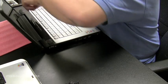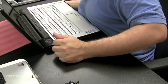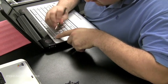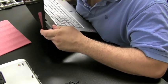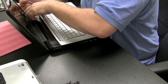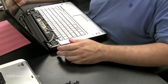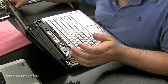The first thing I'm going to do is get that hinge cover plate off. It's different on every laptop — some laptops don't even have this hinge cover plate — but this is the key to getting the keyboard and screen off. Gently put some pressure on the sides and try to pull it up. Now since we have all the screws out from the bottom, we know there's no screws holding this plate in, so just pop it up and let's look for water damage right on the spot.